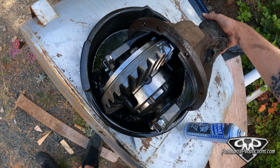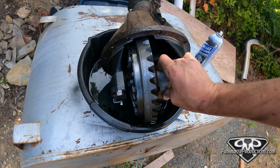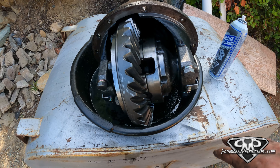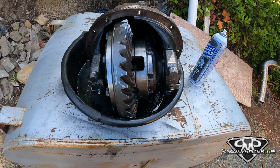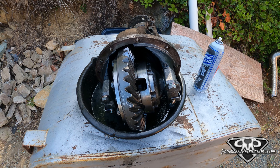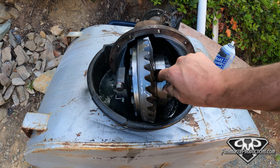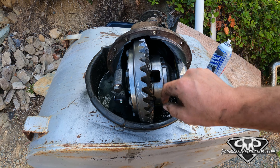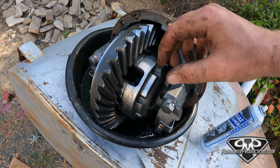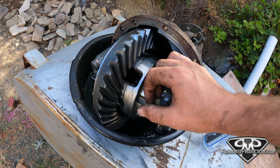35 to 8 — so we could do some math, I believe that's 4.38s. Because this is an LSD rear end, limited slip, which is super common on the H233Bs, Nissan Pathfinder rear ends. You'll find the limited slip ones way more common than the open diff ones, which in some ways kind of sucks because it's a lot easier to weld an open diff. Because there's a whole bunch of clutch pack stuff going on inside here on either side, and in theory they get tight and lock up the rear — but in practice they don't.